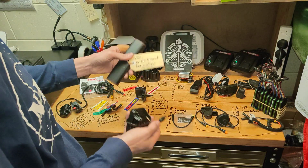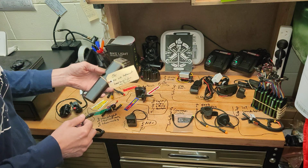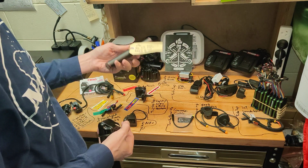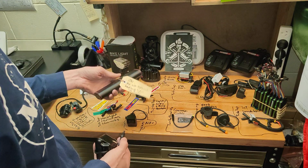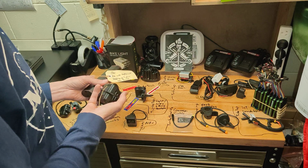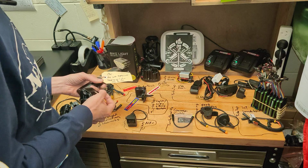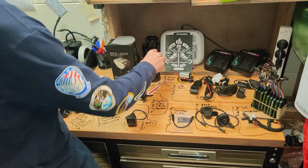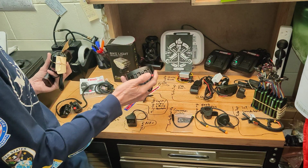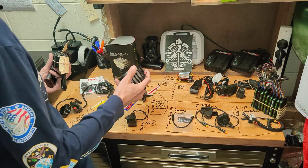This is not exactly this one, but it's just to show the concept of an external battery with 6 or 8 cells in it. This one here's probably got 4 cells, so it'd be twice the weight of that, and that's probably about 500 grams. So it'd be a kilogram of battery you'd stick in, at 7.2 volts. High current, run about 30 or maybe more, 40 watts for the 5,000 lumens, to a really nice fixture that manages heat really well in a Turbo Torch. That can just basically plug in and replace that one, for that red 3-pin connector on the NAMI.